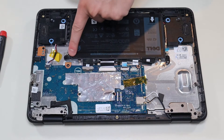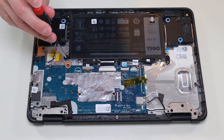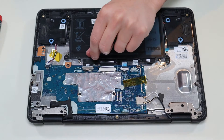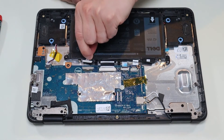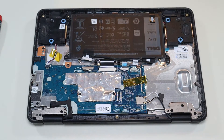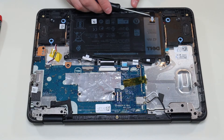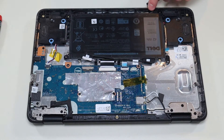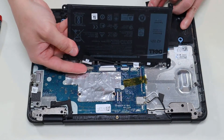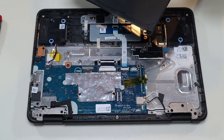To get the battery up, there's a screw there, there's a screw here, and then the battery plugs in right there, so I'll take out those screws first. This battery unplugs pretty easily — you just grab this black tab and pull down toward the battery and that unplugs. There's a little black piece of tape right there that's holding the battery down, so that needs to come up. There was also some double-sided tape holding your battery down.